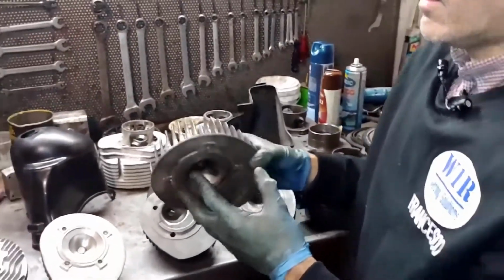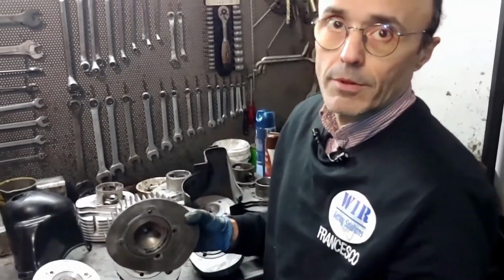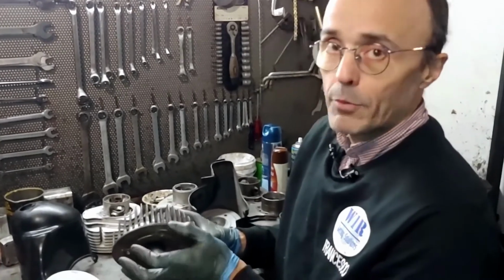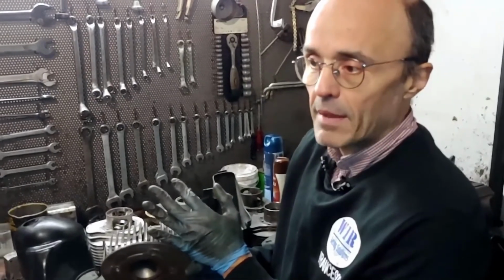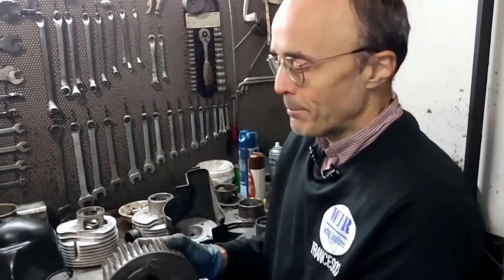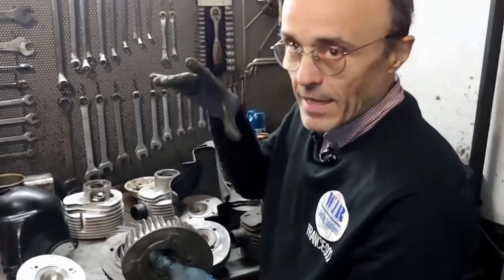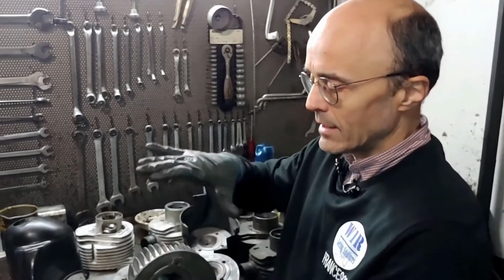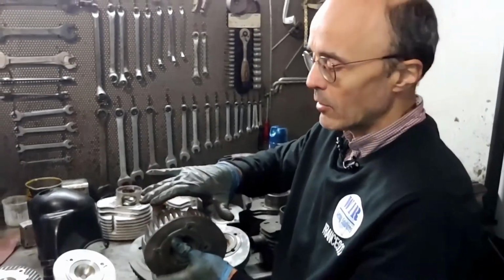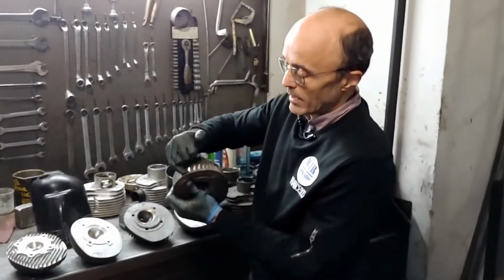It's clear that this work must be done with great care. I mean, create the channel, yes, but remove aluminium in moderation, because the larger the channel becomes, the more aluminium is removed, the less the radiating surface is. So you get to a point where there is more damage than gain, because the air, as the current passes along the path of least resistance, and if two large openings are created, in the meantime a surface is removed in which the heat exchange can take place, and then the air can find an easy escape route, especially if you touch the last fin.